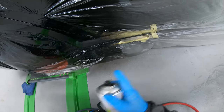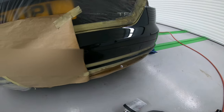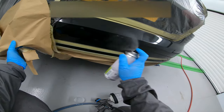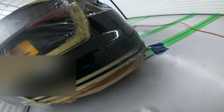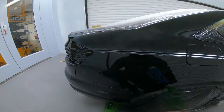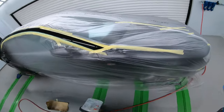5700S fade out thinners. You don't need to go crazy here — just get a light coat on there and it melts in. It melts the old lacquer underneath the paper into your new stuff, and obviously you polish it up and it becomes one with the old and the new. I'm just blending it in towards the lacquer here. Make sure you're happy and just take a little look over — always check. This is now the time to make sure you're happy before you put it on, clean your guns out and stuff. There's nothing worse than cleaning your gun out and then finding you needed a little bit more here or there. So really take the time — it's going to save you a bunch of time later on if you spot something now. Thanks for watching.